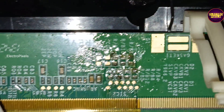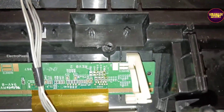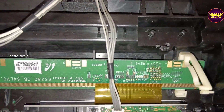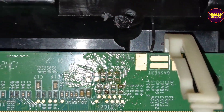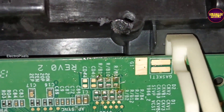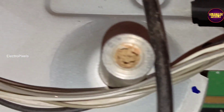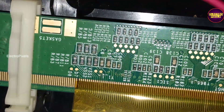So here we don't need to use the cutting method. We just need to remove those resistors from one side of the panel and check whether the display is stable or not; otherwise rejoin the tracks using a jumper. Here we are going to first remove the right side resistors which represent the gate signals.